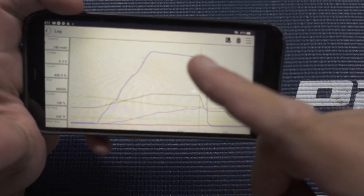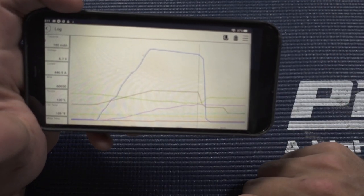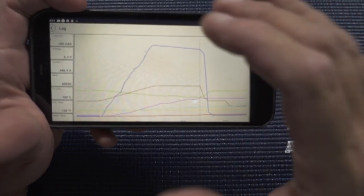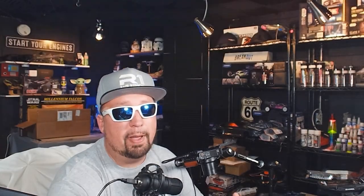If you've got all kinds of stair steps going on in your RPMs or in your amps, that means you're slipping in certain spots and you'll have to adjust your tune — whether it be less timing, delaying timing, or increasing the amount of time it takes for timing to come in. There are all kinds of little tricks of the trade that we will talk about right here on this video. That should be a good basis to start with. Actually, we should probably look at the M17 first, so let's do that.